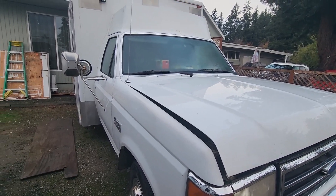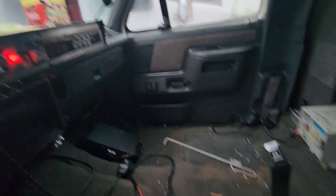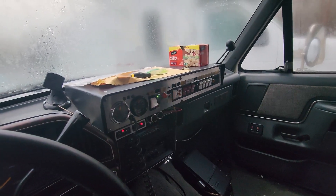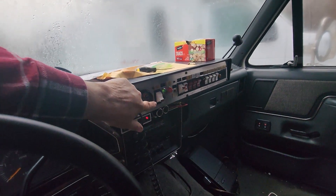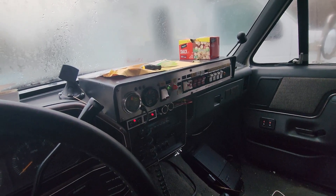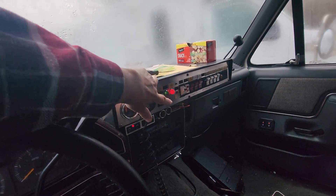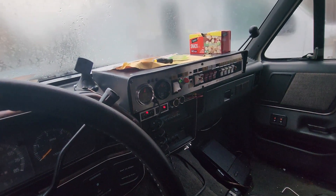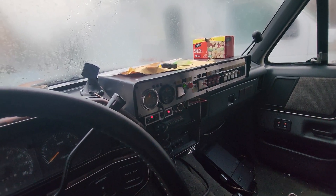The engine is up front like a pickup truck, with an ambulance on the back. With the truck batteries connected, the control panel is live. And even with the master switch off, it's still drawing current. This is what I want to isolate, so that when they have the truck off, nothing in the back is running. Only when I turn on the master switch will it turn on all the power. That will save their truck battery life, and the master switch will be running from their house power, not from the truck power.